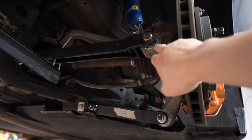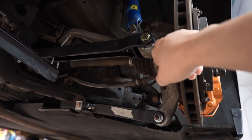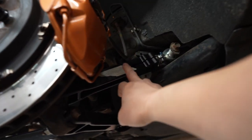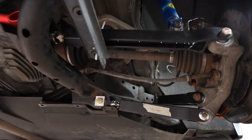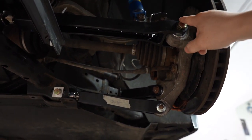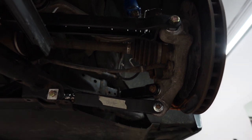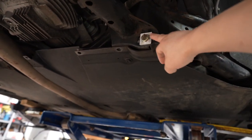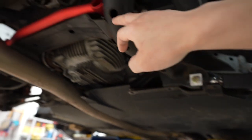Just want to give you guys an overview of what I replaced: on the rear knuckle we replaced all the rubber bushings to spherical solid bushings — toe arm, camber arm, and the traction control arm. Looks pretty sick. I adjusted all of them and installed the eccentric lockout kit for the camber and inside here for the toe.